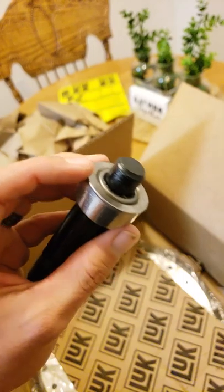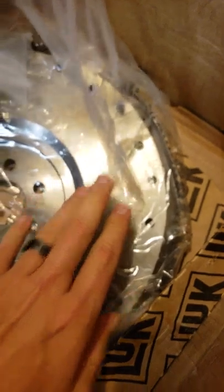Super old. Typical. New pilot bearing. Clutch alignment tool. And what I was really worried about is the flywheel — I didn't know if they would actually come with the 50oz balance that the 302 needs. But yeah, here's your 50oz balance. Everything looks good so far. I see no teeth marred or anything like that, and I don't see anything cracking.